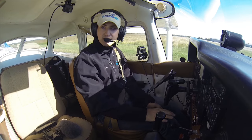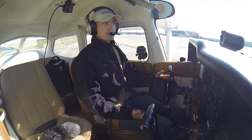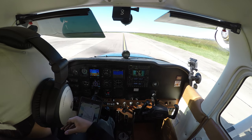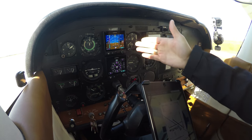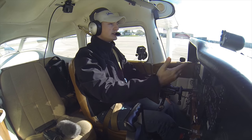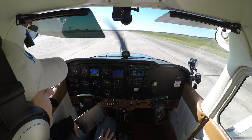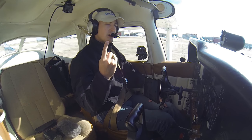It's really great that the market is starting to open up for glass instruments and modern tech for old airplanes like this. We have an aging aviation fleet. The really nice avionics and tech is only either in jets, the really expensive airplanes, or experimental. For the certified aging general aviation fleet, it is great to have stuff like this starting to get certified. Dynon just got the big Skyview system certified for the Cessnas and Pipers. These Garmin G5s were an absolutely awesome solution. I'm really happy with it — it interfaces with everything great.